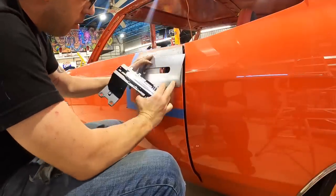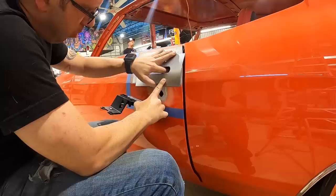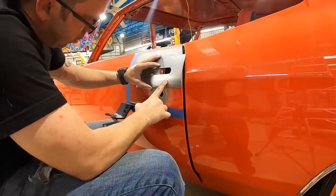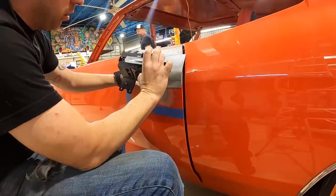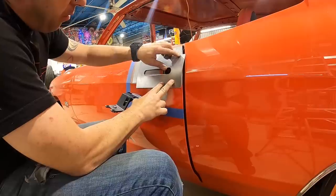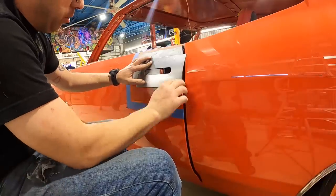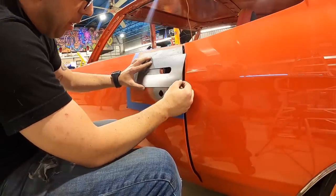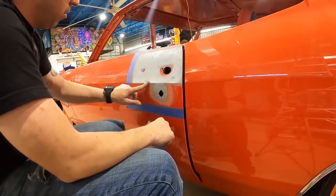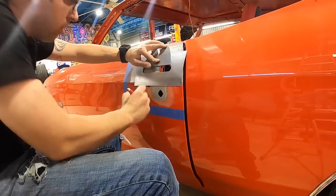I have to make sure that this thing lines up — the positioning of this plate is going to be pretty crucial in order for it to work. I'm thinking I have to go a little bit lower and further back, which means I'm going to trim it back a little bit more. I'm going to take off this leading edge and then we're probably going to go into the body line down here, as opposed to trying to make another break on the bottom — it's always easier going into existing breaks on body panels, a lot less warpage.